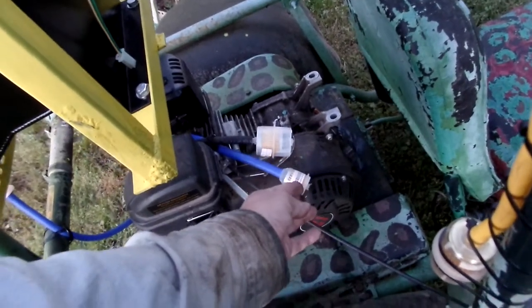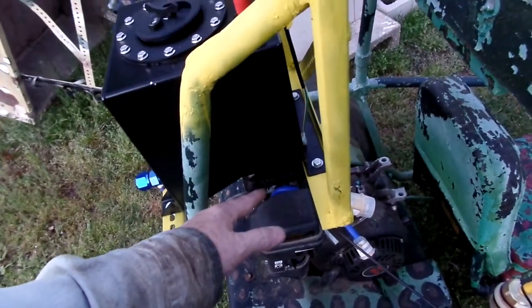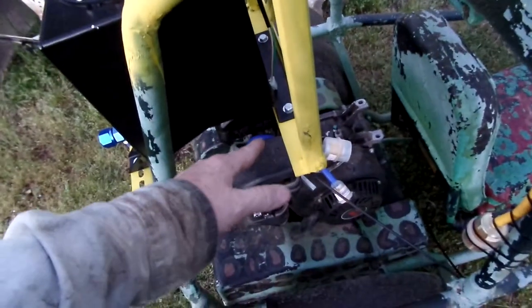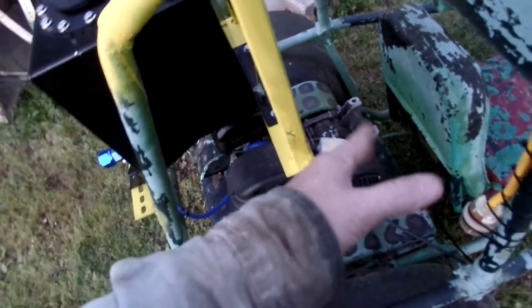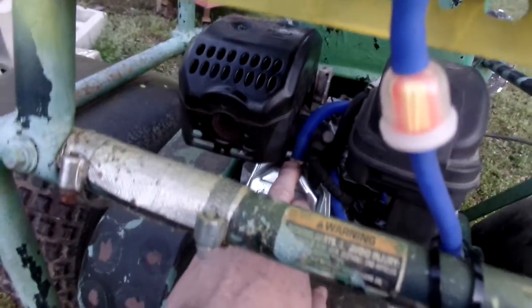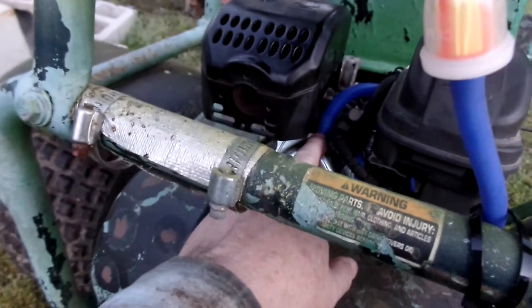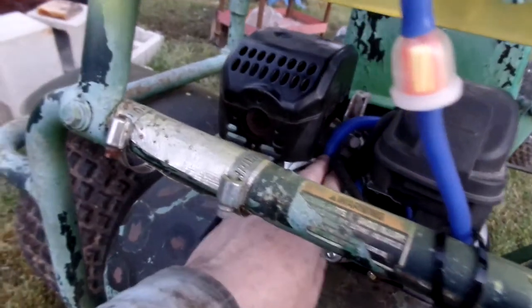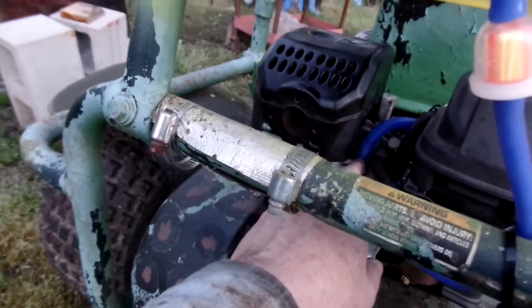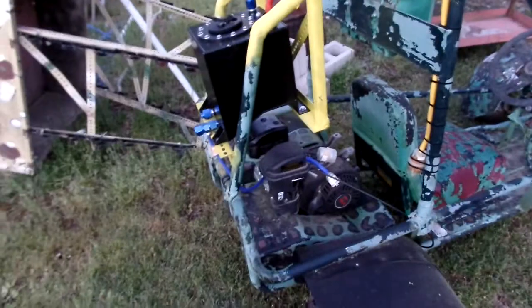You'll notice I put these air filters on because they breathe, but I knocked the end off of them to signify that's for windage. If you've ever been around a lot of these motors, there's a lot of air moving around inside — and that's free horsepower if you can vent that air out. So I used a nipple, you can see it right there, tapped it in. Everybody likes to use that for their pulse, but a small manifold would be a better vacuum source. Cutting out that windage makes it run more efficiently.